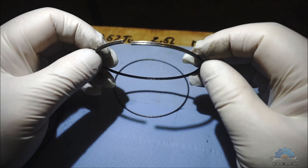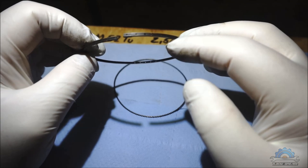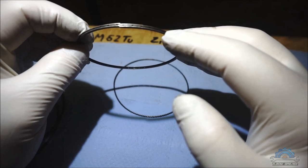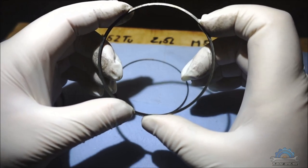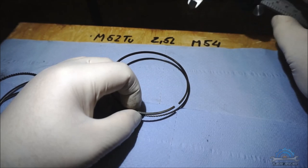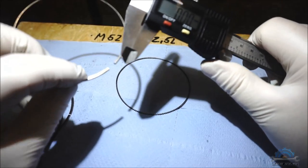That's why the M54 burns oil — these rings don't withstand high temperatures and pressure. If you do an aggressive ride with lots of highway mileage, they wear very quickly. One good tip: if you're replacing M54 rings, you can use M52TU rings and fix the problem by using the old-style oil rings.